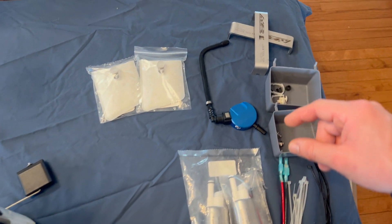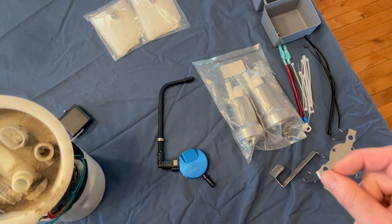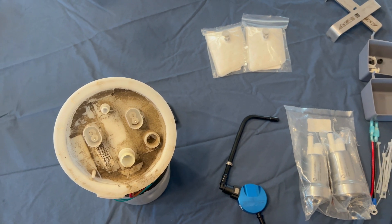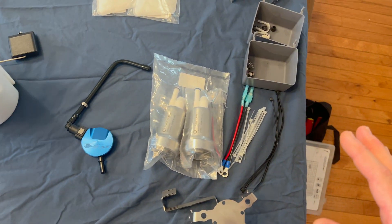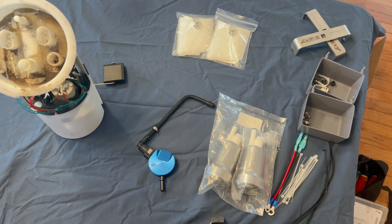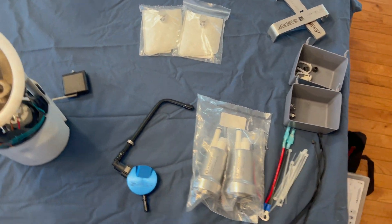We removed the fuel bucket. I definitely think this is the best bang for your buck if you want to stay with a bucketed fuel system. There are lots of guys doing bucketless fuel systems, which is great, but I definitely don't like the idea of running out of gas at a quarter tank — these things guzzle fuel.